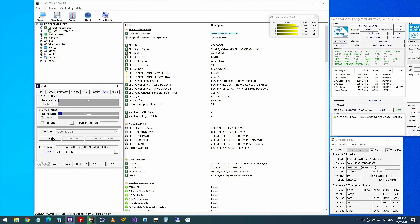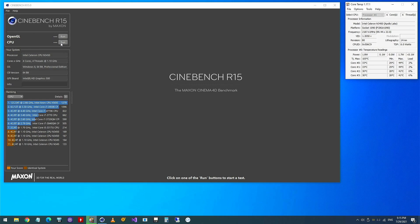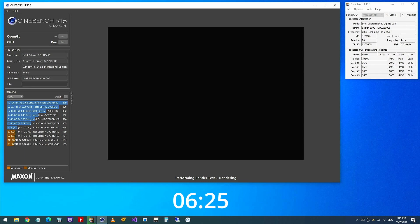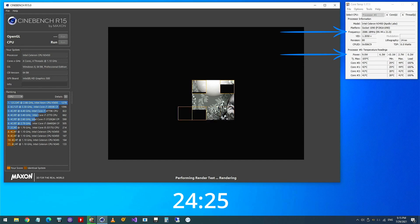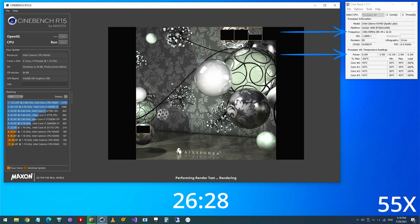And therein lies the problem, because this CPU has a power limit after 28 seconds where it automatically reduces the drawn power to 6 watts. In order to see this behavior, we would have to run a longer benchmark. Cinebench R15 is a good benchmark that can be used to demonstrate this. Initially we start with a full boost frequency and a maximum power draw of 9 watts, but as time passes by, the CPU is limited to the power target of 6 watts. Once we exhaust the boost frequency window of 28 seconds, the CPU will downclock itself to 1.6 GHz and 6 watts power draw. This behavior of the Intel CPU will result in reduced performance for longer workloads. There is no option in the BIOS to disable this behavior.